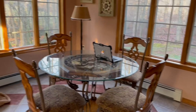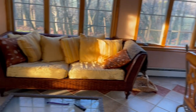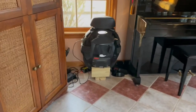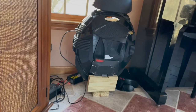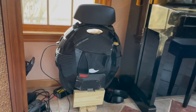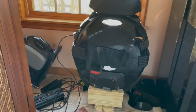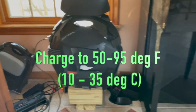How else can we maintain the battery? Charge and start your battery at normal room temperature — lithium-ion batteries don't like temperature extremes, and charging at extremes can cause degradation of battery components. Let your wheel cool down or warm up to room temperature before commencing charging. Charging should be between 50 to 95°F.